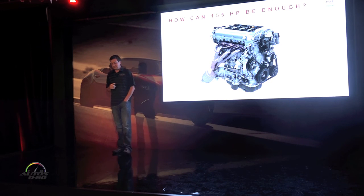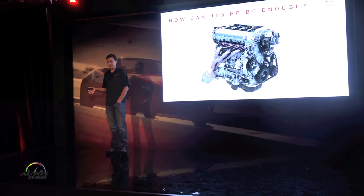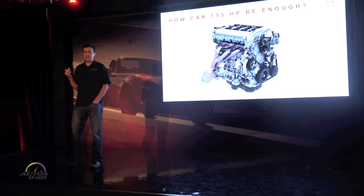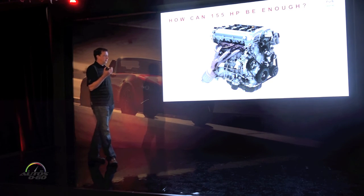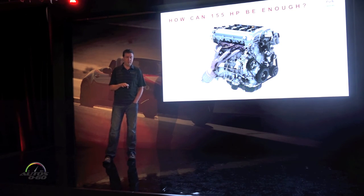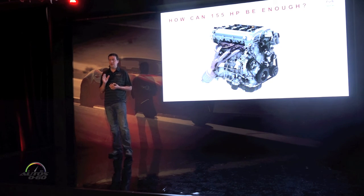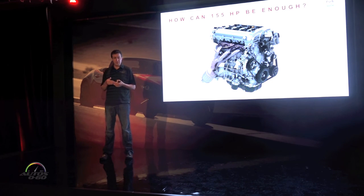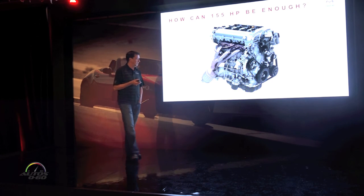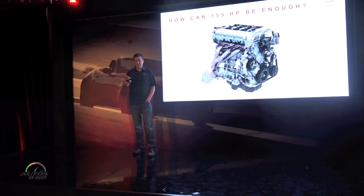We also tuned this engine for premium fuel. Normally this engine has 13-to-1 compression tuned for 87 octane, which is a big challenge to avoid knock. When you want a really sharp throttle response, the quick load transients when you snap the throttle open will tend to make it knock, so we tend to soften throttle response when tuning for regular fuel. Tuning for premium, we can tune for a really sharp response — and that's where all the effort went in the tuning of this car. We also worked hard to get a really linear response feel through the pedal.